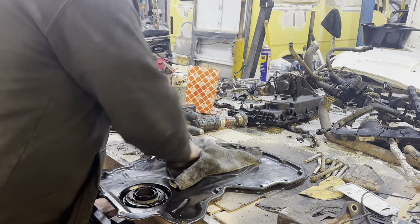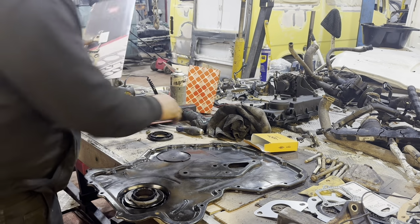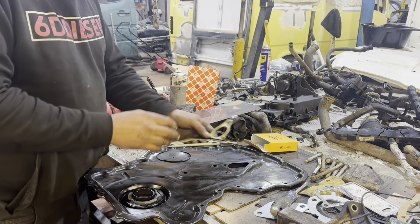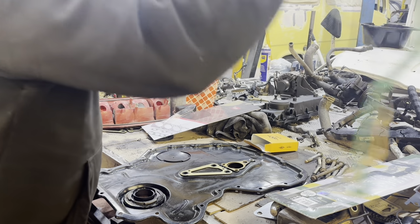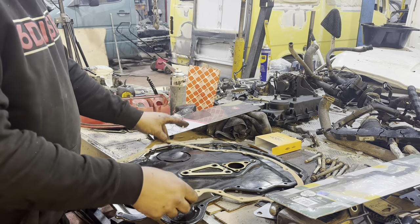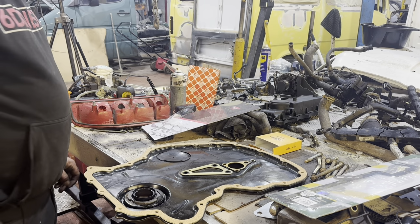Now there are some gaskets that you need to change on the back here. So your engine kit comes with one of these, basically one piece. That sits there. And then we've got a huge, great cork ring gasket to replace the nasty board-based silicone. So I'll get slapping all this on, and then that'll seal the front up nicely. And once we've done that, we can get attending to the rocker cover. Stick that on, and then we're on to engine wiring.